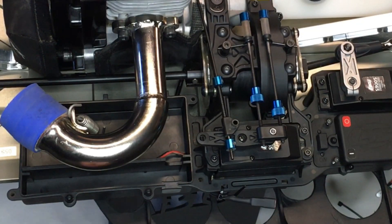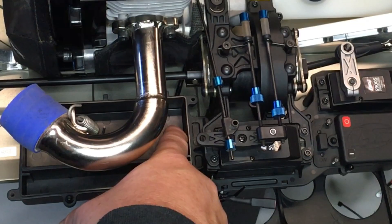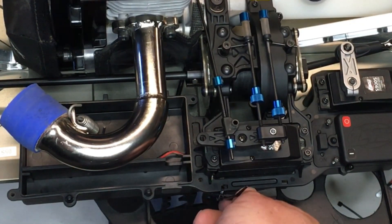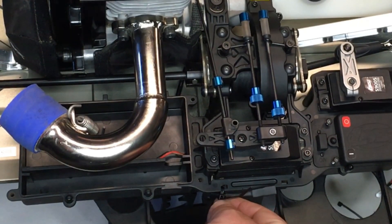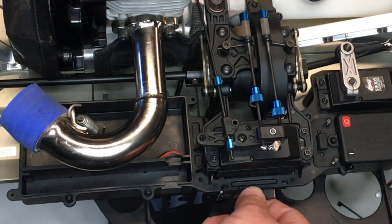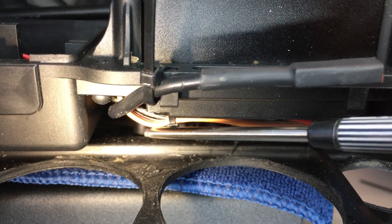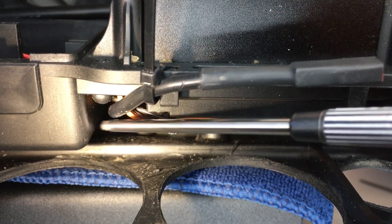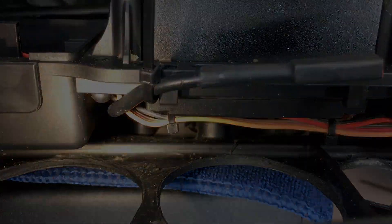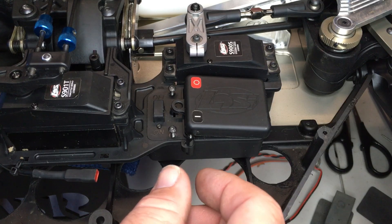Now that we have the motor back in the truck, trace your wire underneath the battery tray. There is a mounting bolt from the battery tray to the chassis — run it behind that and secure it with the provided zip tie to this mounting point. This will keep any moving parts away from the wire and prevent cutting. As you can see, the wire is traced around the post from the battery tray mount, comes up, and is secured there, keeping it away from any moving parts. We will now move on to installing the front portion of the kill switch harness.